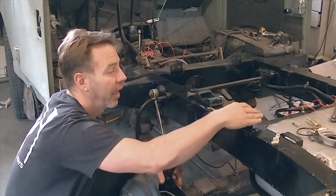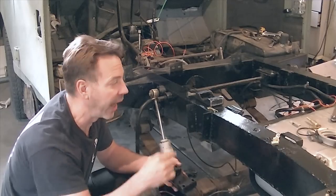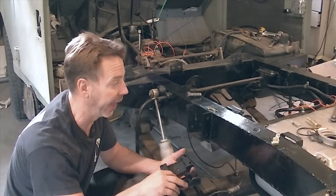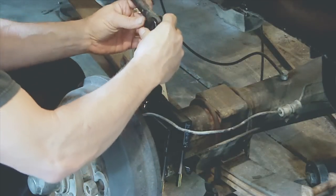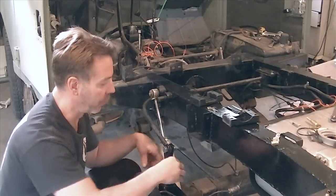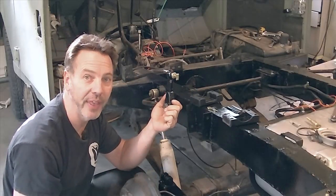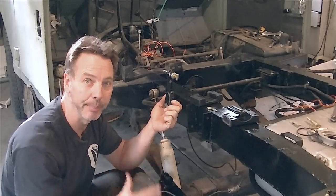Two things on the bracket: the bottom of the axle on the driver's side is actually square, while on the passenger side it's actually rounded, so I had to compensate for that — just remember that when you're working on it. When this is all attached, it's an easy operation. When I don't need the sway bar, this will pull up and I'll have another bracket up above here — the pin will slide in and hold the sway bar up and out of the way so I can use the full suspension travel and it's not going to bump into anything.